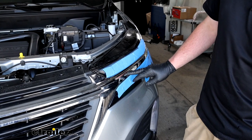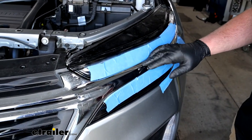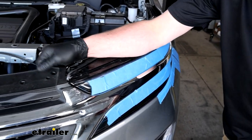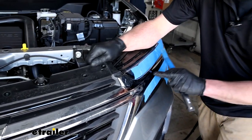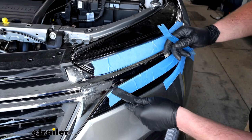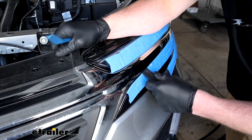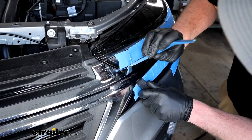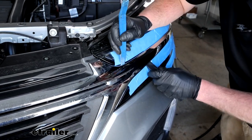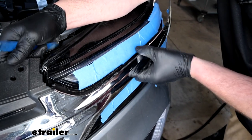What we need to do now — we're going to have this chrome piece that runs along our headlight and we have to unsnap that. You want to be really careful with this part because this is all one piece of our fascia, so we don't want to break it — it's pretty brittle. I put some painters tape around here where we're going to be working. You can also lift it up on this corner to try to loosen things up, and you can spray soapy water in that seam too — that seems to help sometimes. There are just some clips behind there holding this in place, so take plastic trim tools and carefully work your way down to get it unsnapped. If it's super tight, don't force it — try to move down a little bit to keep loosening everything up.